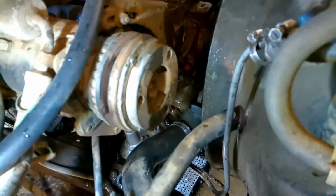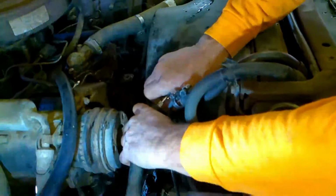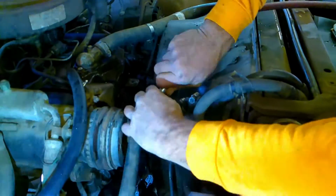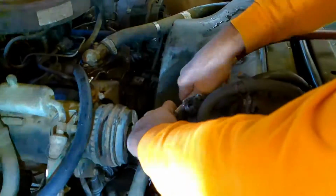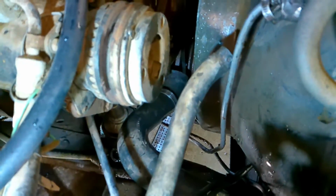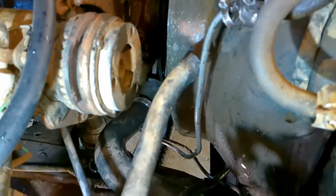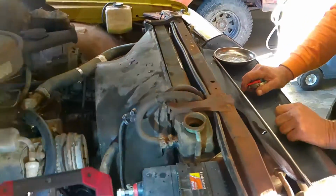And with that, I'm going to go ahead and gently blow out the heater core. Second. Blows it back into the engine, no problem. All I got to do is this again. And we now have a dry motor. That's called a dry motor. We're good to go. Next comes the hookup and the prep and the fill.